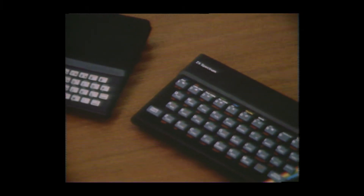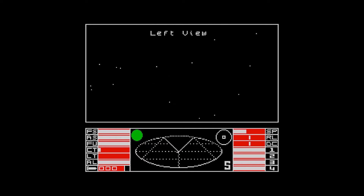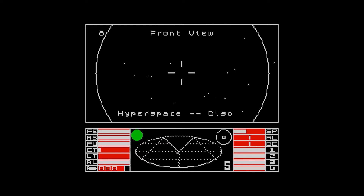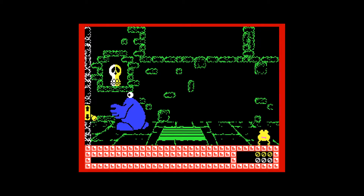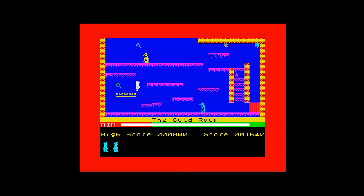The Spectrum, compared with the ZX81, right from the off, it was going to be colour, so that needed different hardware. It needed extra software to deal with the fact that pixels had colours associated with them. The display was made of sufficient pixels grouped together in a square to make a letter, and each letter had a foreground colour and a background colour — so it worked kind of the same way as black and white would do, except that now you could replace black and white with other colours. So that meant it certainly needed extra memory allocated to the colour information, and it needed some extra code for dealing with the different colours.